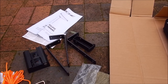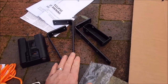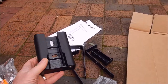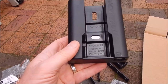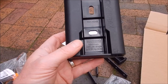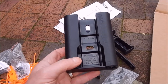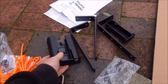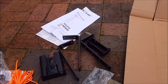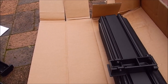First thing to do is fit the Rax Brax to the awning itself. There are three brackets that come with the awning, but I've only got two Rax Brax. However, the Rax Brax is rated at 20 kilos per single unit, so two will hold 40 kilos — and this awning is only 11.5 kilos. The Rax Brax lines up perfectly with the awning track, not a problem.